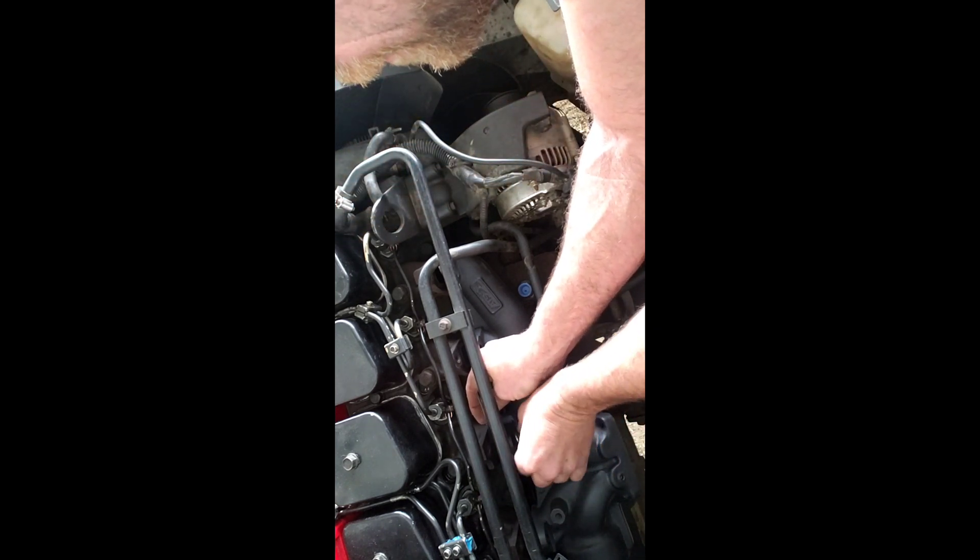Here's how I put the exhaust manifold gaskets on. I laid the new manifold up and put a bolt in two spots — number two and number five — nice and loose. Pick any one spot, start the first hole. You don't even have to have the gasket turned out; you can have it up like this to make it easier to hold. Spin it in, get it started, let go of the gasket — it'll swing down — then thread it on loosely. Do this to all six.